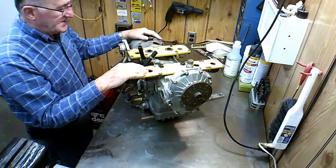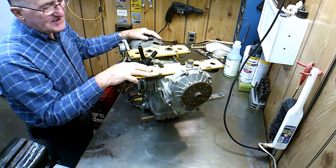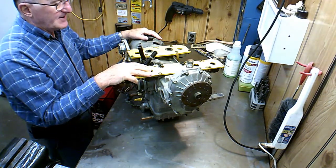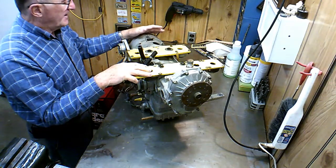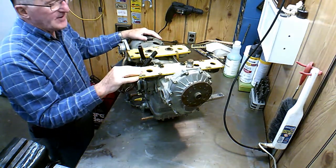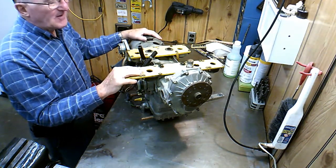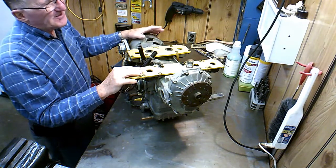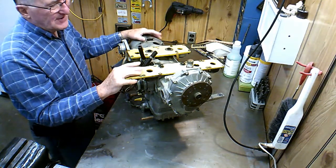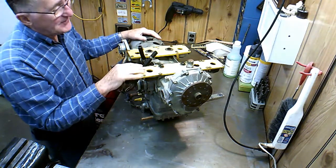It's an old engine, basically. But I've made some modifications to it, and I want to take it apart and see how bad it's worn, if there's anything wrong with it. I've done it several times. I usually decarbon it about every 350, 400 hours. I certainly wouldn't run one of these more than 600 hours, or you'll probably have to put new pistons in it.